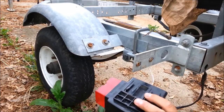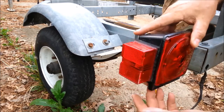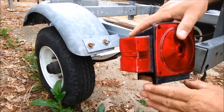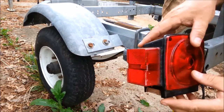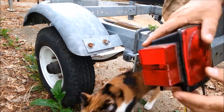This is a trailer that's meant to go in the water. And if there's an air leak here, when you submerge the back of the trailer, water will go up through the light bulb service hatch here and slowly raise up and get to the contacts and damage the bulbs and the wiring and all that. So we have to seal this.